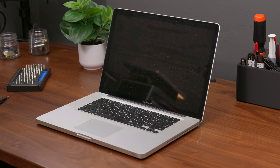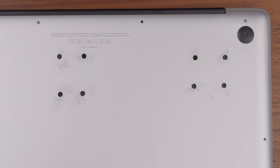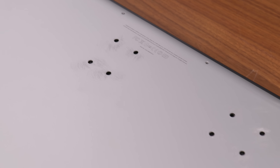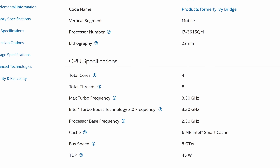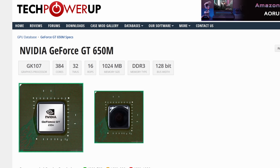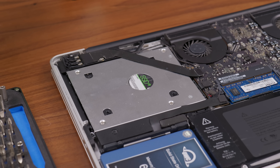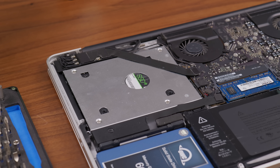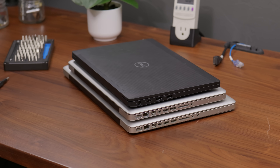Next is another 2012 MacBook, the 15-inch model with better specs, which is why I bought it as an upgrade. The WiFi was busted when I got it, so I got a good deal. Those holes on the bottom of the case — those were my doing. I was being thermally throttled, so I had the idea to drill holes in the bottom for more airflow. It was harder than expected and I only did four per fan, but it actually helped a little. The 15-inch has a 4-core 8-thread i7-3615QM and NVIDIA GeForce GT 650M graphics. The internals are very similar to the 13-inch model, and it already has that optical drive adapter for a second SSD installed from when this was my daily driver. The I/O is basically the same as the 13-inch, just with split audio jacks.